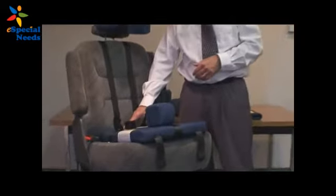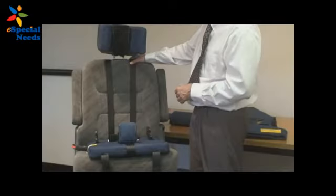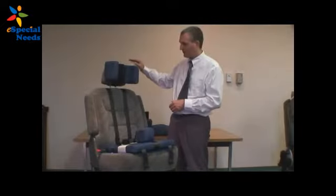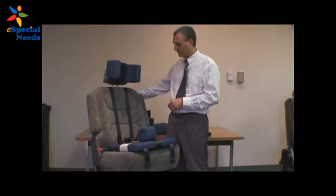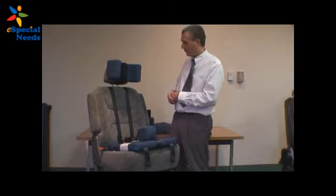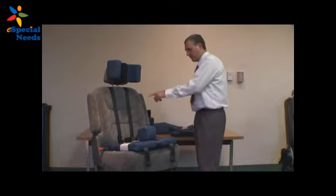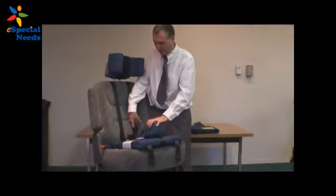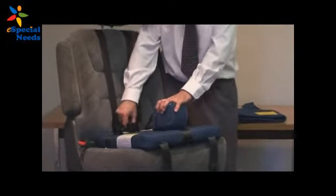The bottom end is connected on the Churchill base itself and the upper end goes back to the tether anchor in the vehicle. That tether anchor may be on the back parcel shelf in a sedan, or on a minivan or SUV it's going to be either on the back side of the vehicle seat, underneath the vehicle seat, or on the well behind the seat on the floor. You can tighten or loosen these support straps with the pull straps.